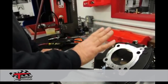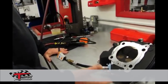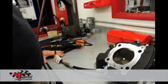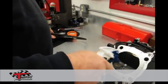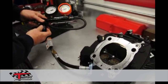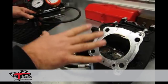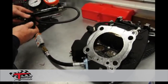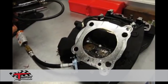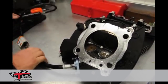First, I want you guys to understand that we have lapped these valves into the valve seats, and we've put a heavier spring on the back side so that when you see this, you'll understand that this is not it leaking past the valve seat. What we did — I'm going to put a little bit of liquid here, just like you see right here. We take a leak-down gauge, and we're adding about 20 — well, right there is 12 pounds — and as you can see, it's starting to bubble. This is not around the valve seat; this is the outer part between the head and the seat itself. That's with 10 pounds. Keep in mind when you do a leak-down test, you're putting 100 pounds of air in the chamber.